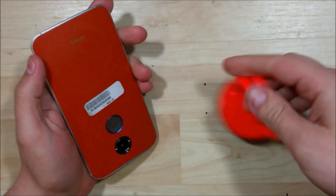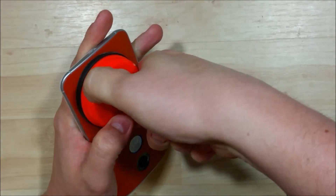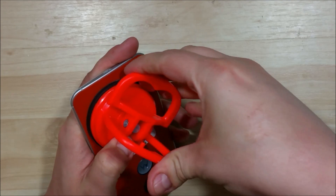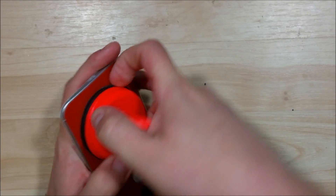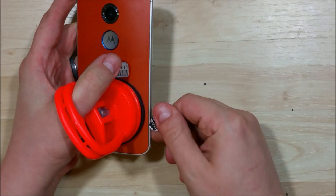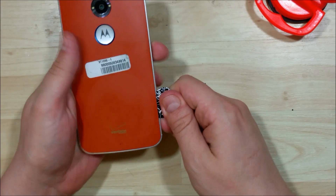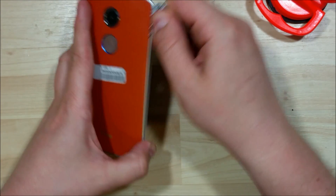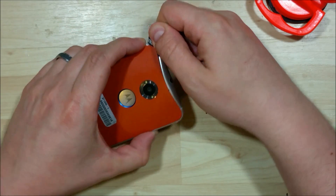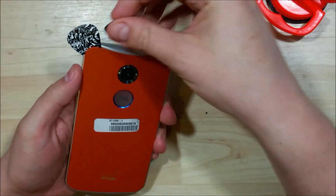You want to make sure you don't go over the little hole in the back right here. You can see my suction cup just popped right off — there's a tiny mic hole almost. You just want to put your suction cup below or above that hole. So we're going to take this, pull it back, and you can start to see that the housing down here is gapping. We can go ahead and put our tool in and start to pull this back.